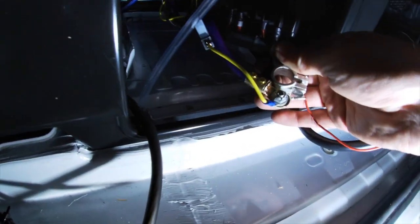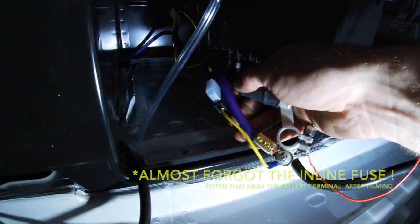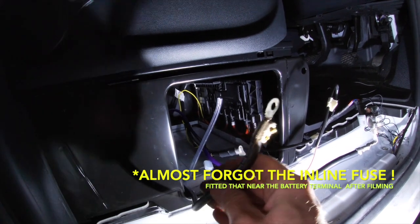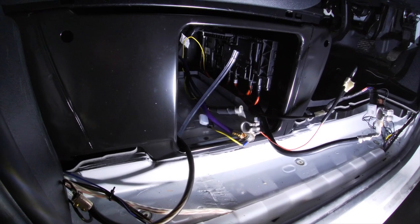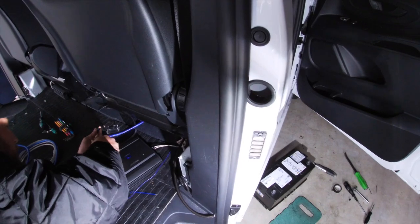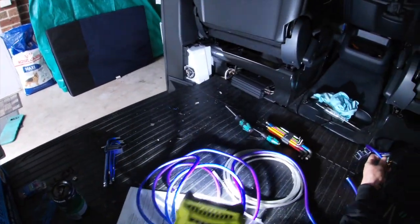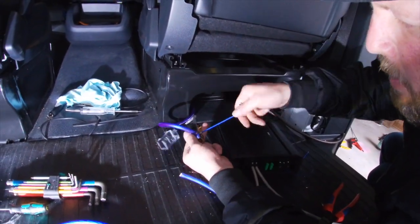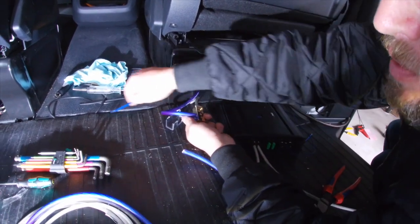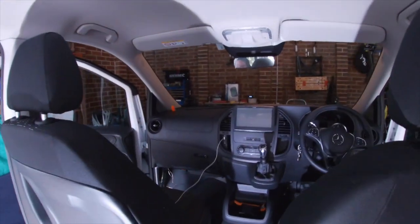The battery is almost ready to go back in. I've got these nice connectors on the blue power cable, insulated against the original loom. The earth lead will connect onto the negative. In the back, the amplifiers are going in — the main speaker amplifier is all done under the seat. We're using a splitter from the four-gauge main battery wire, which then goes into an eight-gauge power wire to each amp, with another eight-gauge going directly into the subwoofer amp.